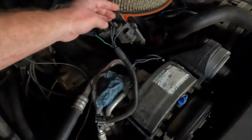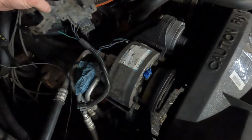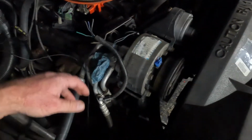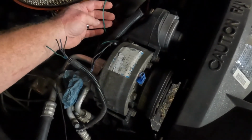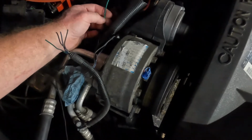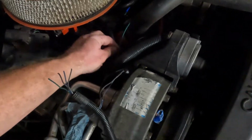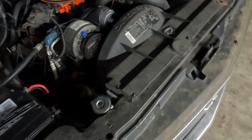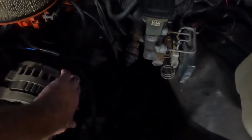It drives me crazy because we got all this stuff laying around. There's a purge valve there that's been disconnected. That's probably part of our check engine light. MAP sensors just laying around. Jacob rewired the knock sensor wire the other day, but I think we're gonna have to come back here maybe and wire up more. The coolant temp sensor has been chewed through by a rat, and so has the alternator. So the alternator, I had pulled it off, got another pigtail for it. Everything's here.